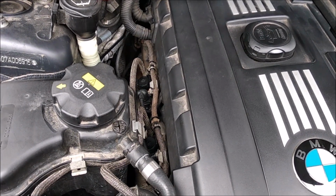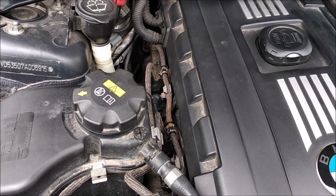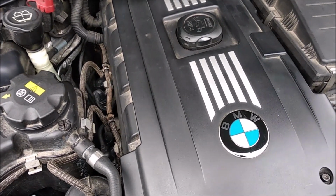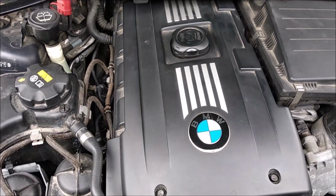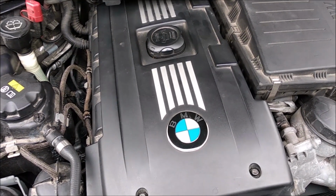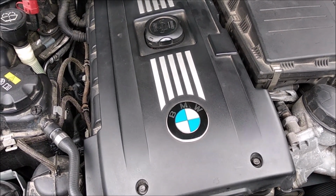And guess what? It stopped burning oil. Surprisingly, there was no white smoke coming out of the pipes at a light at all. I noticed that the turbo started to rattle badly at cold start and when letting off throttle. My guess was that someone adjusted the wastegate actuators with some kind of tune to mask wastegate rattle before selling the car, which ended up with turbos burning oil because of the wrong actuator rod adjustment.